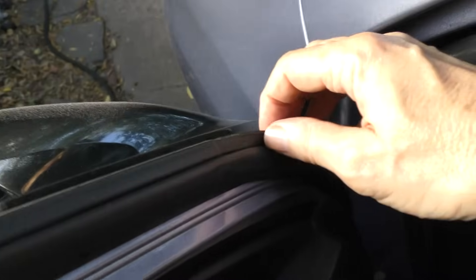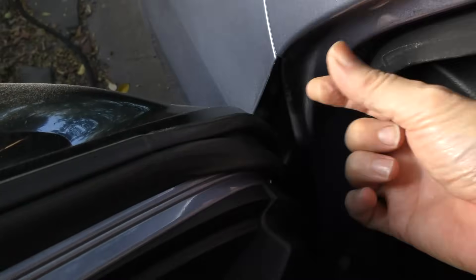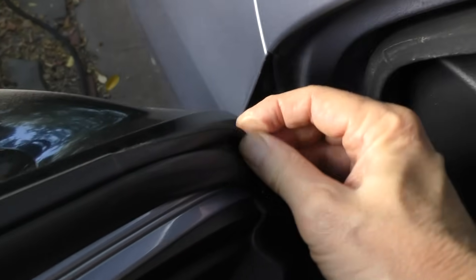And even though it might not look it, this car is 10 years old, and often the rubber seal on the door will go bad. So we'll inspect that first. And when we check it out, I can find parts that are really squished — they're not resilient, they don't come back, and have rips and tears in them. So we're going to change the door seal.